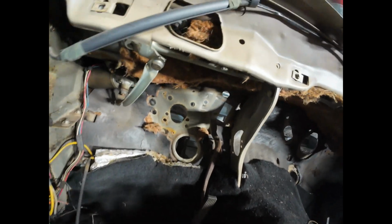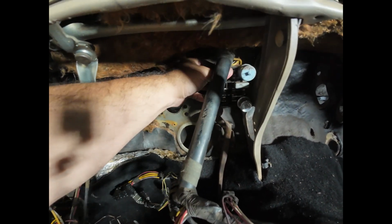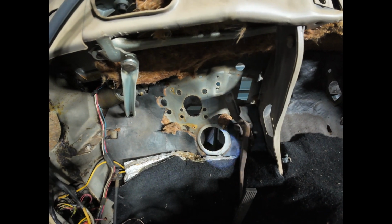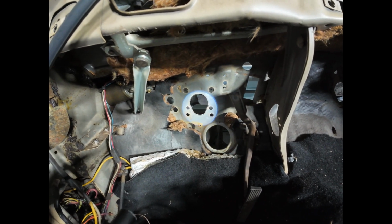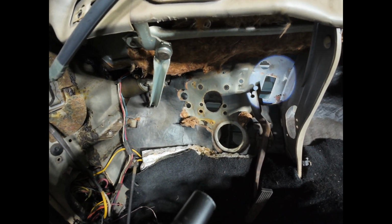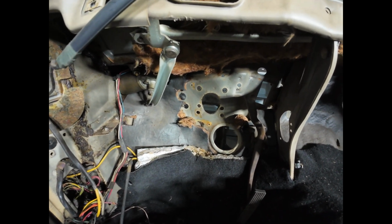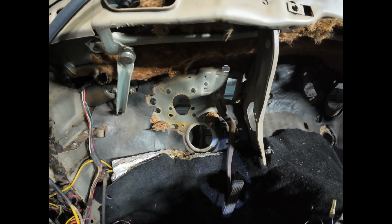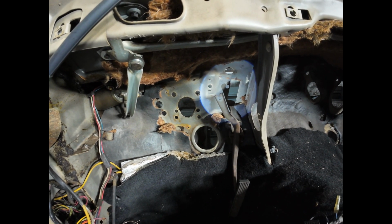And so when the fuse box is in place, this thing sits behind the gas pedal up there. It's a really awkward place to get it. I mean, if you think about it, the steering shaft and the brake actuator are 2 things that you normally can't get at. So is the wiper motor, and the fuse box is even higher up behind the dash than those things. And this is a 70s style car, which means the seats are mounted down low, the dash sits down low. The position you have to contort your body into just to gain access to the fuse box, that alone is worth looking at a different place to put it.